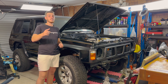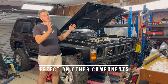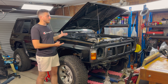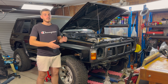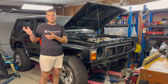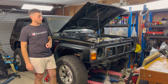That brings me to point two: you've got to think about the effect on the other components. You can't just drop a thousand horsepower motor in and hope everything else is gonna be sweet. The gearbox becomes the next weak point, then your drive shafts — I'm gonna need custom drive shafts to handle the power. Follow the power down the line; everything has to be upgraded, otherwise you'll snap something the first time you go out.